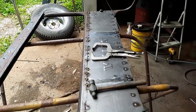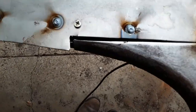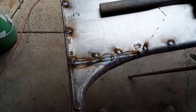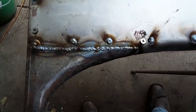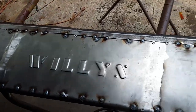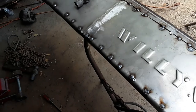There is going to be a little bit of a dip in it so I will have to do some body work — but I mean, what do you expect. Now I've got to do this side. Got it welded on both sides and I rolled it all the way across — did really, really good. It rolled right under there and looks just like it did from the factory. Now I've just got to weld the top, then pull the screws out and weld them up, grind it down, and be ready to sand it and paint it.